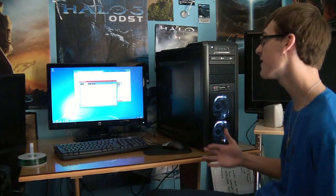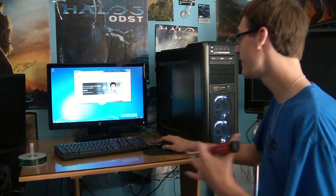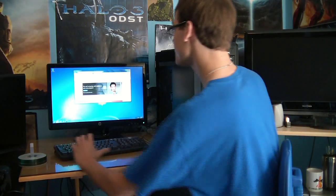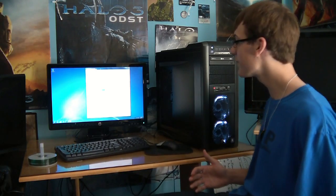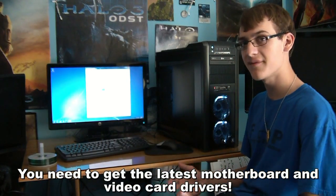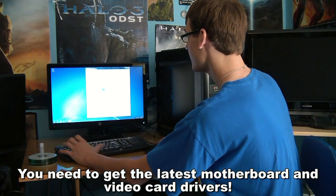Because it's a new computer, it's not going to find anything. While Security Essentials is scanning your computer for any threats, we can now move on. What do you prefer — Firefox or Chrome? I think I like Chrome better. We're going to use Internet Explorer for its true purpose of downloading another browser. So we're going to install Google Chrome. Now you have Google Chrome installed. One final step for maintenance: you're going to want to download the newest drivers for your computer. Coming installed with your computer you get your driver CD, however getting the drivers off that CD they're going to be outdated, so you're going to go right to their website.